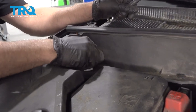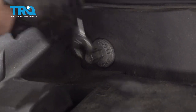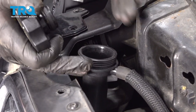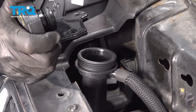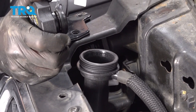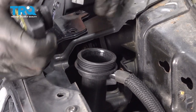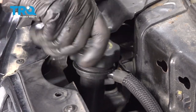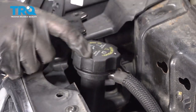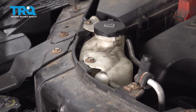Install this ground terminal and snug it down. At this point, you want to add your coolant — check your owner's manual for the proper mixture and the proper coolant. Run the engine for about 10 minutes, making sure you monitor it to ensure the engine doesn't overheat. When the engine's up to operating temperature, you can shut the vehicle down, let it cool down, adjust the level once it's cool, and put the cap back on. Then double-check the reservoir, adjust accordingly, and take it for a road test.